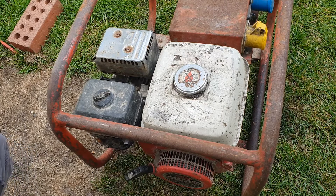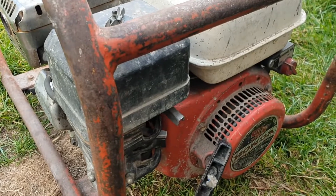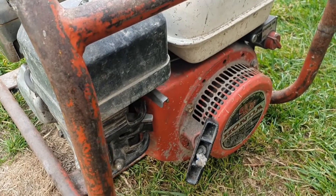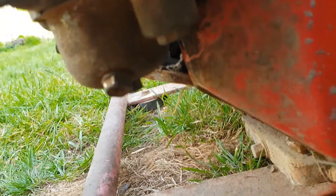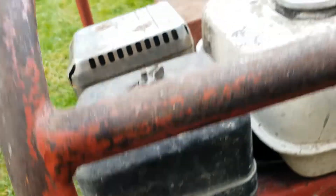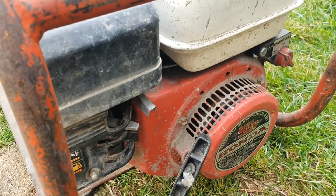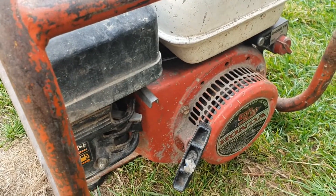These are easy to fix really, unless they're totally buggered — like a piston or something. This one was slightly unusual in that the intake valve had a bit of rust around it, which reduced compression down to about 30 PSI so it wouldn't run. The usual things to check: take the bottom nut off, pull the float bowl out, unscrew the main jet, tap out the carbon — there's a little jet as well, make sure you get both since the top one has smaller holes. Make sure they're clean, check the spark — these are magneto-based so they don't usually go wrong.